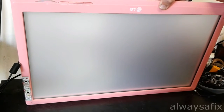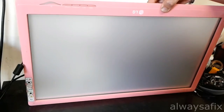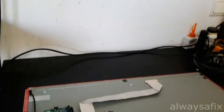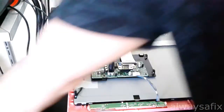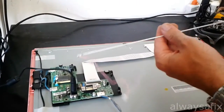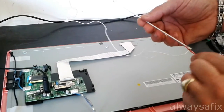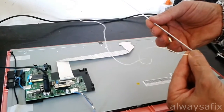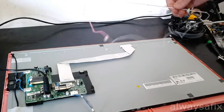So I removed the lamp. The lamp sort of looks like this. One of the sides was black — it was burned. I re-soldered the wire, re-insulated it, and then put the lamp back in.